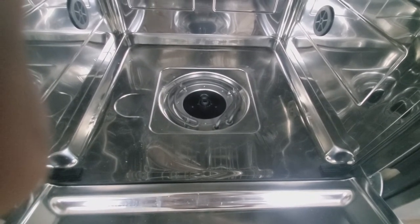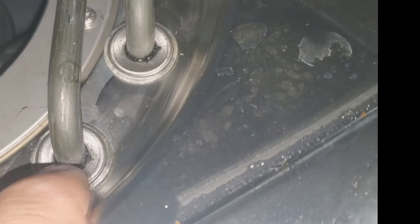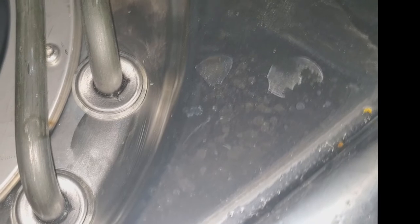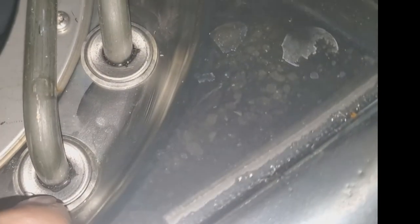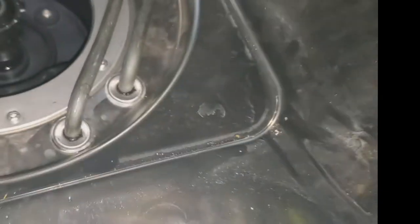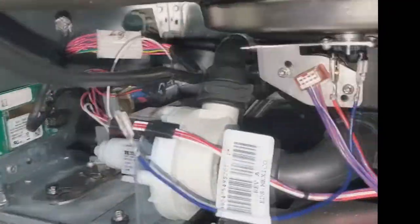You can see how these seals are expanded — the stainless steel washers pulled down on them and expanded them outward around the washer. That's how you want it to look. You don't want to over-tighten it and have the edge of the washer cut through the rubber. Just go back and forth, keep an eye on it, and make sure it looks like that.